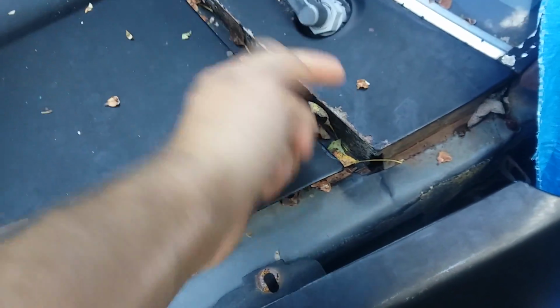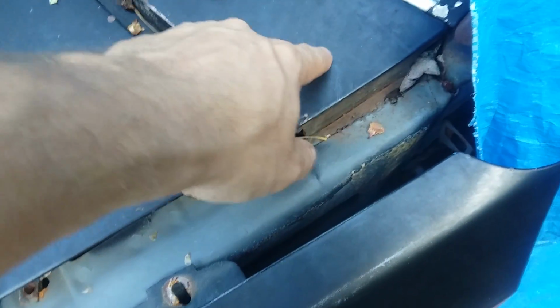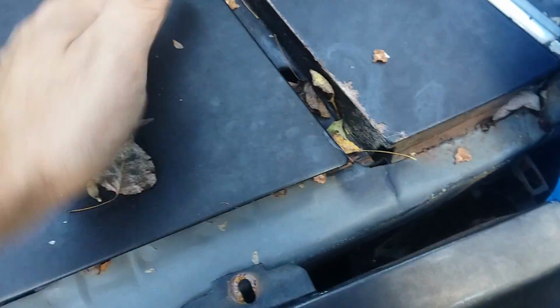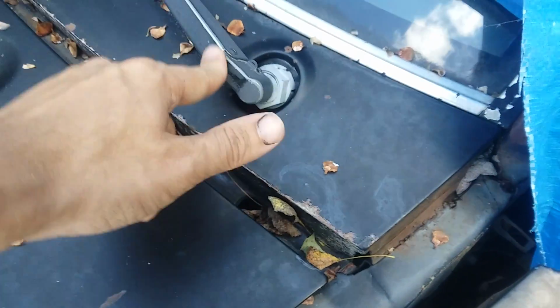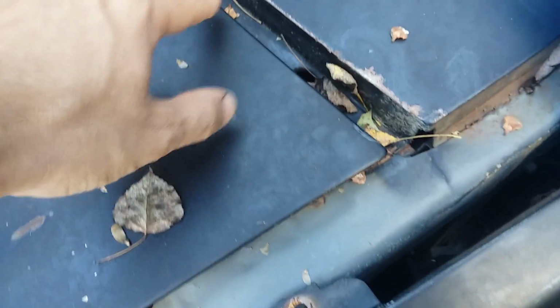And then depending on how bad it's bent, this corner of the hood could poke more here, or more here, or more up in here. It could dent a million things. This portion can also catch and bend the wiper arm. That's what this one's been doing. That's why there's a chip there. It meets up perfectly with that.